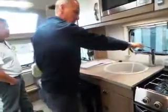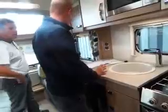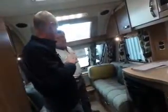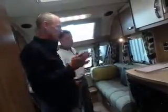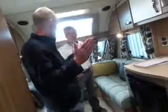There, that's your pump going now. I can feel it. And it should shut off after a second or so. It's pressurising the system as well. Yeah, but it works off a pressure switch in the pump. So if there's air in it, it takes that little bit longer to squash air. If it's water, it'll obviously shut off a lot quicker.